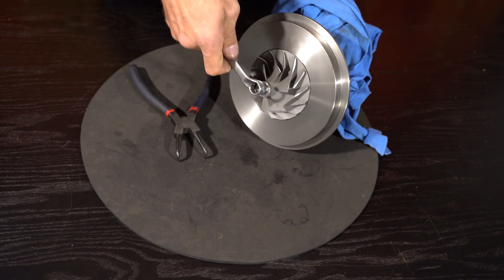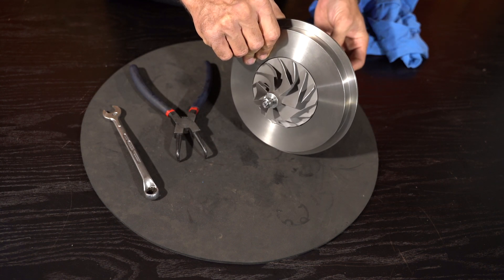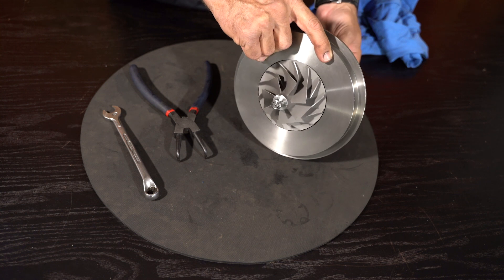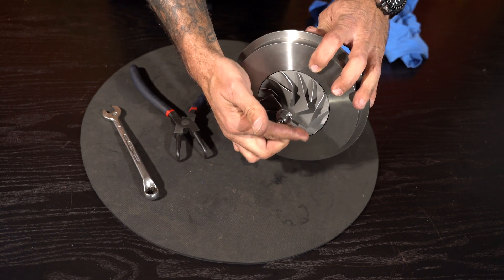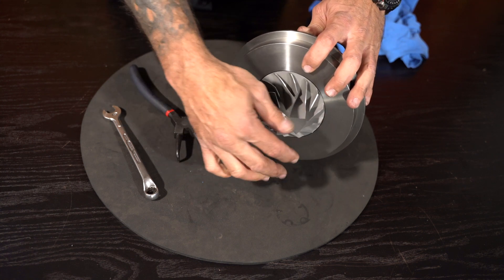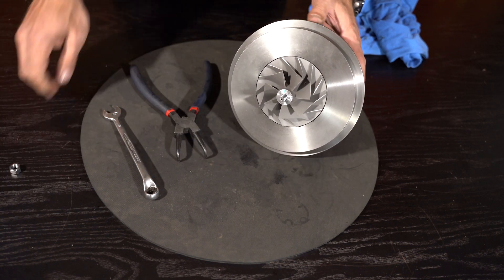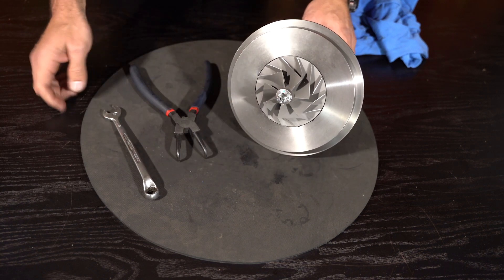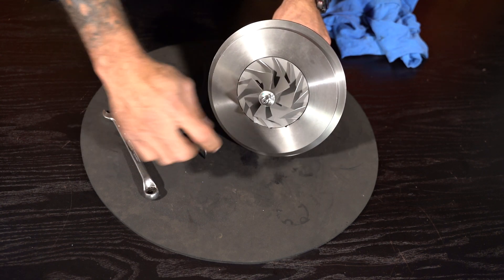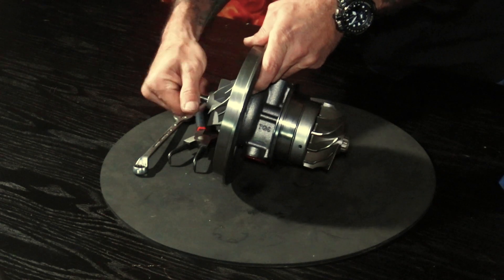This is the direction of rotation — what you're hearing is the heat shield at the back. That is clockwise, and the nut will tighten anti-clockwise, so that the nut automatically tightens during operation and cannot come off the turbocharger while running. Even if I leave this nut on the turbocharger like this — yes, it'll be out of balance — when I start the engine and the turbocharger spins, it'll suck this nut on and tighten it. The nut will never ever come back off again.